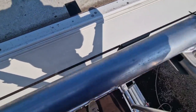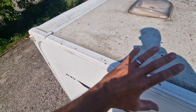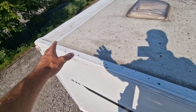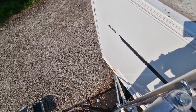Obviously if you haven't got a big stanchion like this, you can use a ladder. Put a towel along the side here and place the ladder against the caravan, making sure the towel is wrapped around the ladder a good couple of times so it's not going to cause any damage to the side of the caravan. Then either have somebody holding the ladder for you or have it properly secured at the base. Obviously you want to go up the ladder safe and secure.